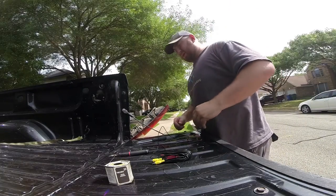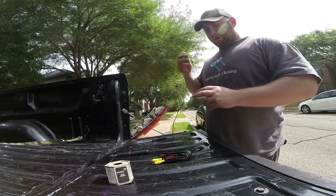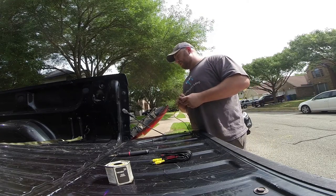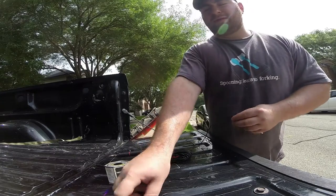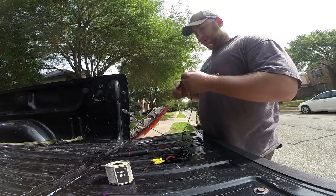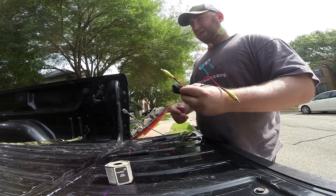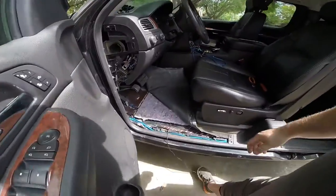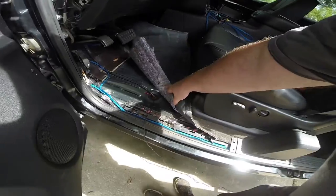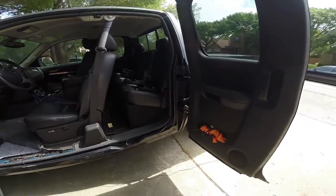The hardest part of today's install is the backup camera. First, take out your tail light — it's two screws and then it just pops out. We're going to wire this power wire for the backup camera to the reverse light down there, so whenever we turn on reverse it will send a signal and take power from that to turn the camera on. This video cable actually needs to run all the way from the camera up to our head unit. For running the video cable, we're using the grommet for the vehicle speed sensor — the VSS. I just pushed it down through and we'll pull it from the bottom and run it alongside the frame rail all the way back to the camera.